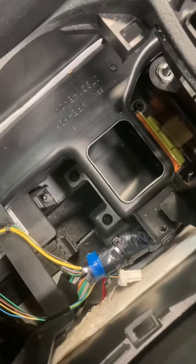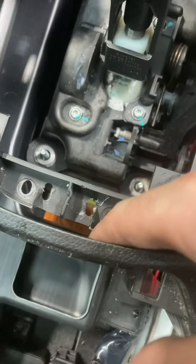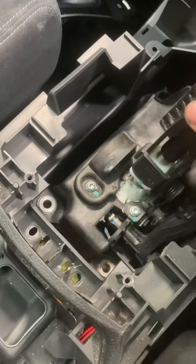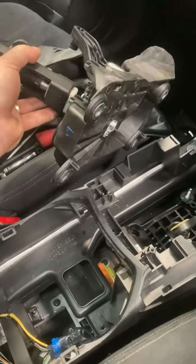Because I needed two hands I can't record it, but we released the screws on the back of this for the cup holder which we pulled out. There are two little tabs on this piece which were preventing it coming out. Rather than stripping out the whole centre console, we removed those two tabs and it pulled out.